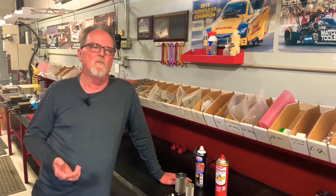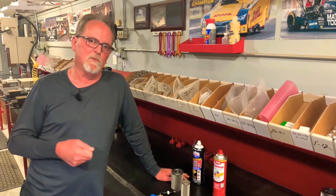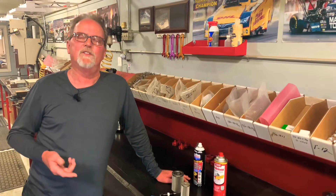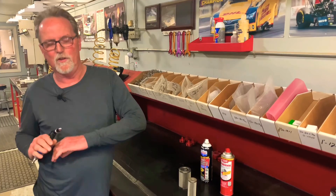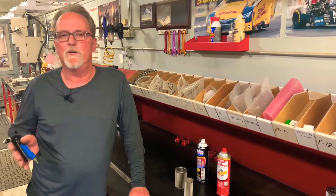Now for some other things you can do if you're going to be down for quite some time: we want you to take care of the fuel pump and all the hoses and fittings. Ideally, take the bottom side of the hose off on the bottom of the pump and roll the motor backwards to get all the fuel out of the pump. Then squirt a couple tablespoons of Marvel Mystery Oil into the top side of the pump and roll the motor over a couple of times so it coats the whole inside of the pump. Do the same thing with all your fuel lines — squirt some Marvel Mystery Oil in there and chase it with air pressure. When you chase it, the Marvel Mystery Oil runs all the way down through the lines and even through the jets. It's not going to hurt anything inside the motor.